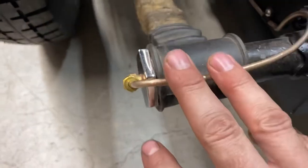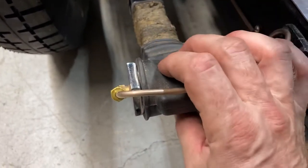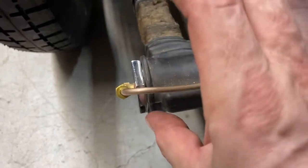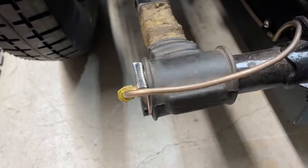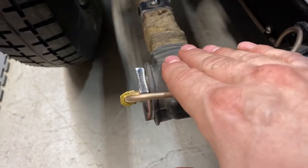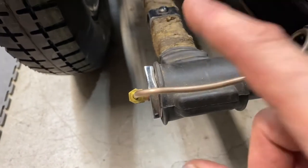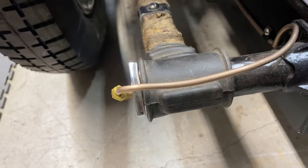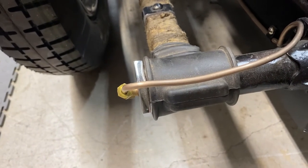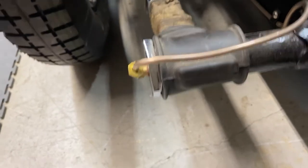This is part of the chassis lube system. This spring slides in a cylindrical brass trunnion in this tubular section here, and it rotates with the movement of the spring — the spring slips in and out as it expands during compression, so you need to keep lubrication on it. That was a problem with this car when I bought it — it was completely worn through, had worn through the brass and right out the top of the chassis tube, which would have been a frightful situation when that whole thing dropped to the ground. I rebuilt all of this with new tubes, new trunnions, and new springs. These lines are meant for oil, not grease, even though they look like grease fittings.